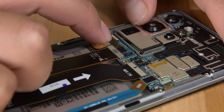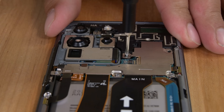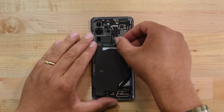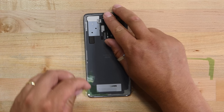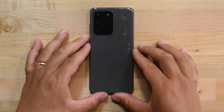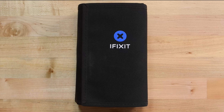You can now safely reconnect the battery. Next, lay the motherboard bracket back into place and reinstall the screws securing it to the phone. Grab your wireless charging coil and connect it first so that it is properly aligned and then you can press it down into place. Before you close up your phone, be sure to apply new adhesive to your back cover. We have a video that walks you through this process linked in the description below. Lay the back cover onto your phone and press it firmly in place. Then be sure to set some weight flat on the top of the phone for at least 30 minutes so that the adhesive seal is tight.